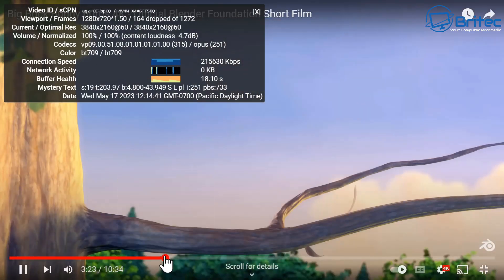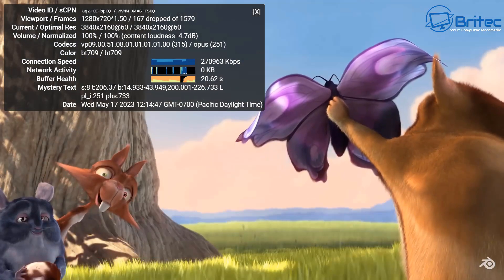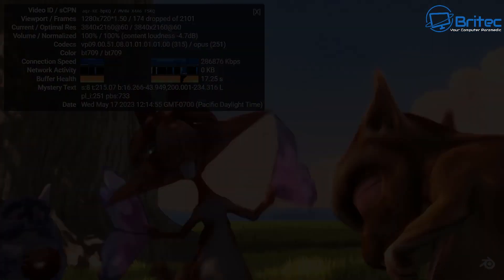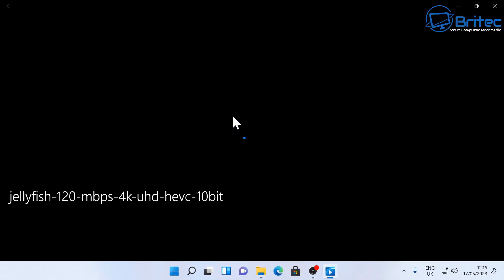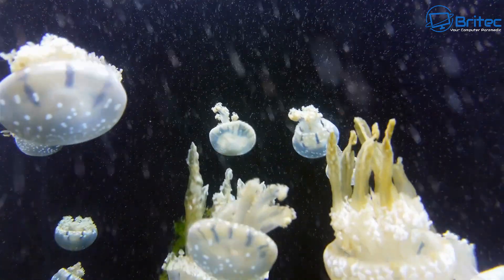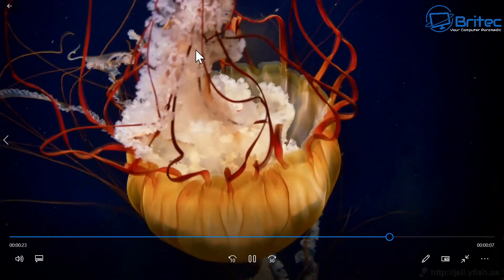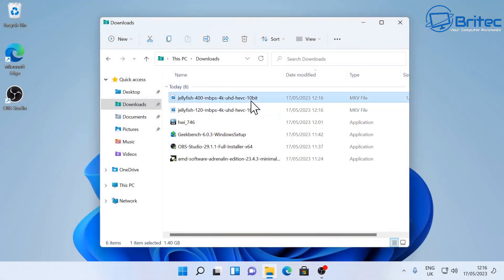4K streaming is pretty good as well. I'm jumping the video here to see whether it catches up — you get a few dropped frames at the very beginning of playback, but once it stabilizes it's not too bad and you get good quality. Next up are some Jellyfish samples, which are really extreme files. This is 4K at 120Mbps, HEVC, 10-bit, and you can see it's running with no problem at all. Skipping ahead, the playback is great, so you can play all your 4K content on this and run Plex.